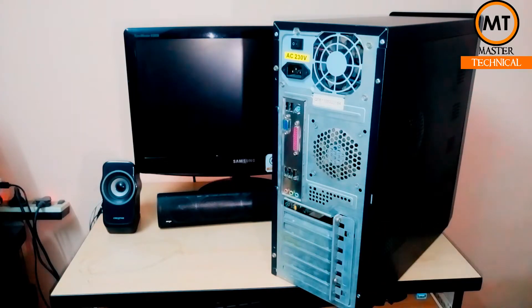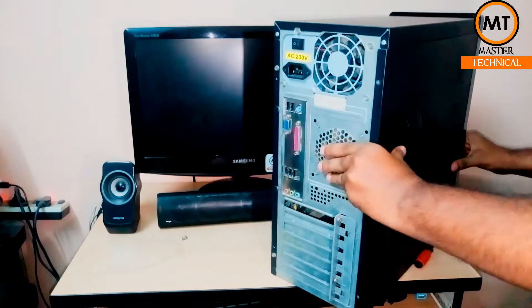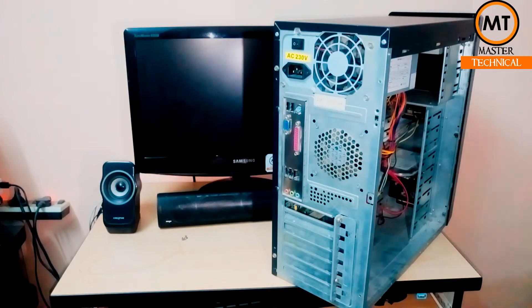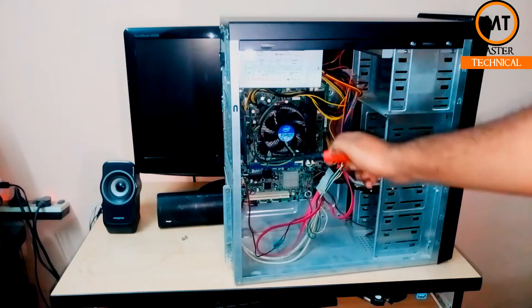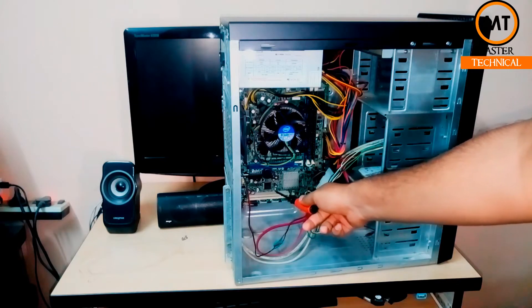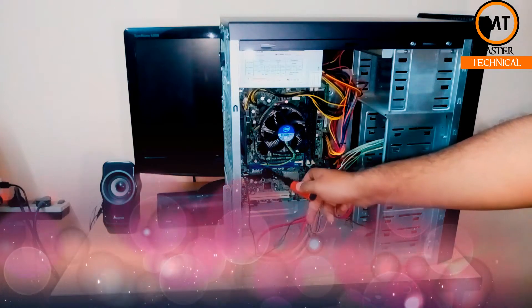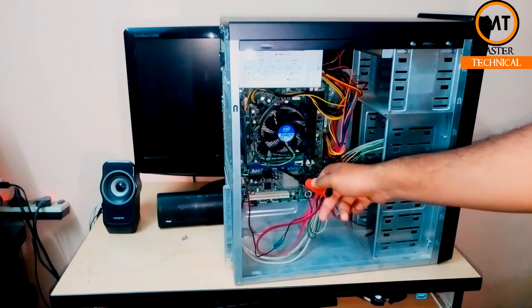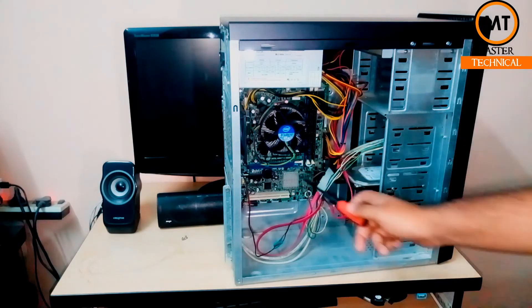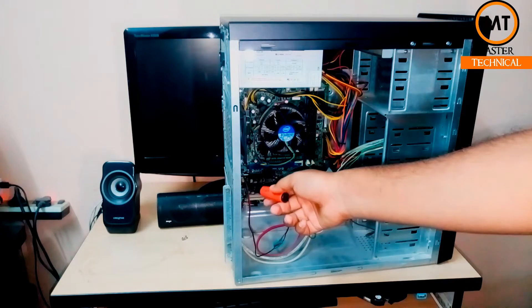Open the CPU — you'll see the processor fan. The graphics card slot is the one with the white color marking; the main slot you want is the blue colored PCIe slot. We will place the graphics card in that blue color slot. On the right side you also need to open the back panel bracket.